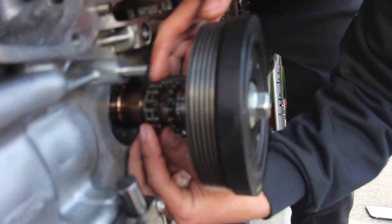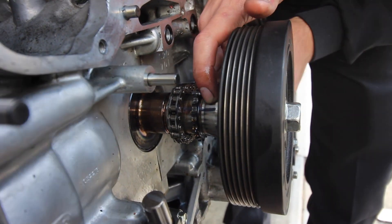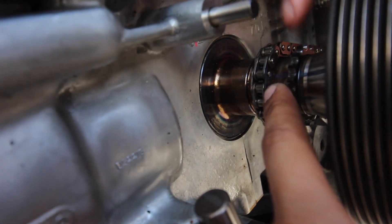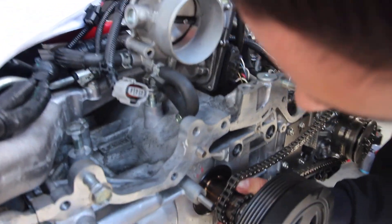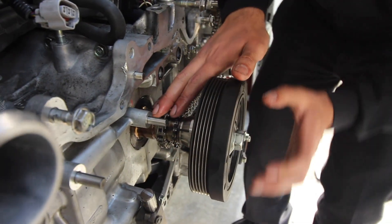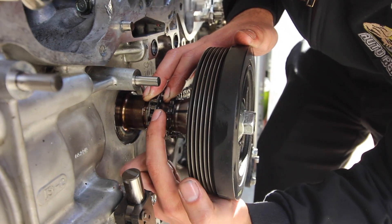The marking right there — the little black sharpie line is the tooth, the timing mark on the crank itself. Because we put the harmonic balancer here, so this little blue one has to line up with that one. That way these stay all in time right here. And this one can go on right there. We just need one more tooth, which should be right on the middle of it. So this marking right here should mark that tooth in there, which is where the blue one is on.